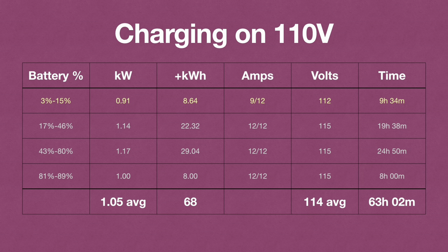On the next row, I go from 46 down to 43 because I had to take my mom shopping. Then I did a final test from 81% to 89% to see if there'd be a trickle effect — but it was basically the same rate as all other sessions. I think the trickle charge concept applies more when you're supercharging and rates drop as the battery reaches 90–95%. If you're already clocking in at one kilowatt, you're already at a super trickle. The whole 110V home charging experience is essentially a trickle.